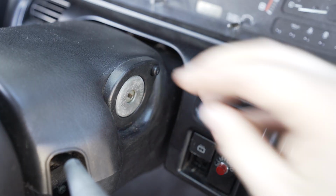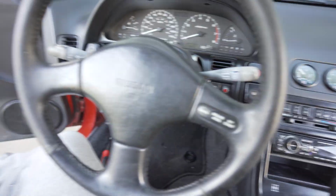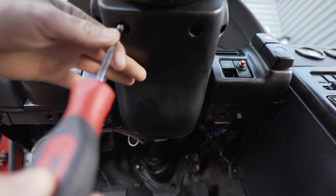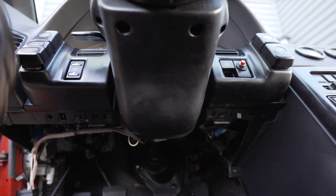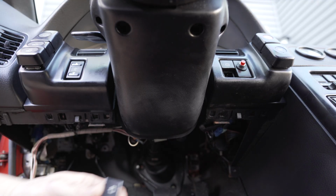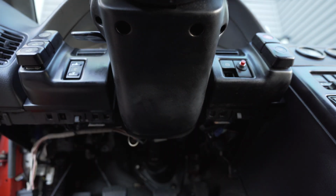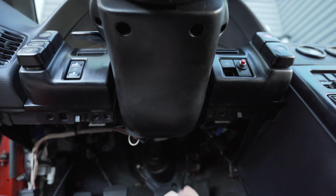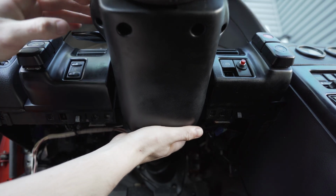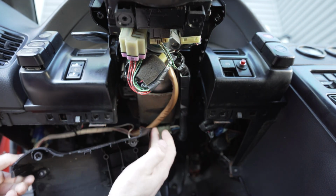Now we're going to pull the clamshells off the steering column. Well, that little piece has to come off first. It's a lot easier than maybe it should have been. I've got one here, second one here. Try not to lose our screws like that. Oh, hey. I just found one of my missing buttons under the, oh actually, button right there. Just found it under the floor mat. That's pretty sweet. Okay, we got that last screw out of there. Now this clamshell should just pop out like that. There we go. Bottom one is off.